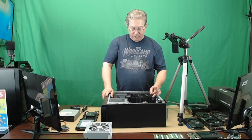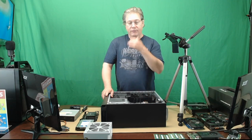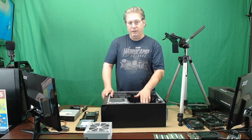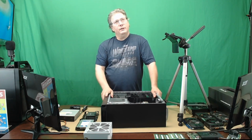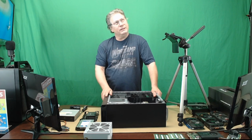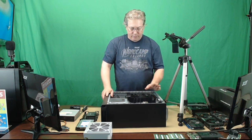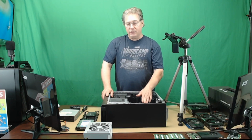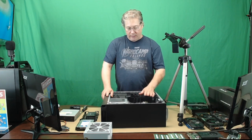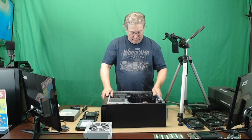But I took it a step further, and I took the older CPU out and put in one of the best CPUs that this motherboard would accept. So we went from a bench score of approximately 3,500 to about 7,000, 6,500 to maybe 6,800, so almost 7,000. And so we really upgraded there. We went from 4 cores, 8 threads to 6 cores, 12 threads. So we gained a lot of CPU power. So we've already done that. I believe everything went well.